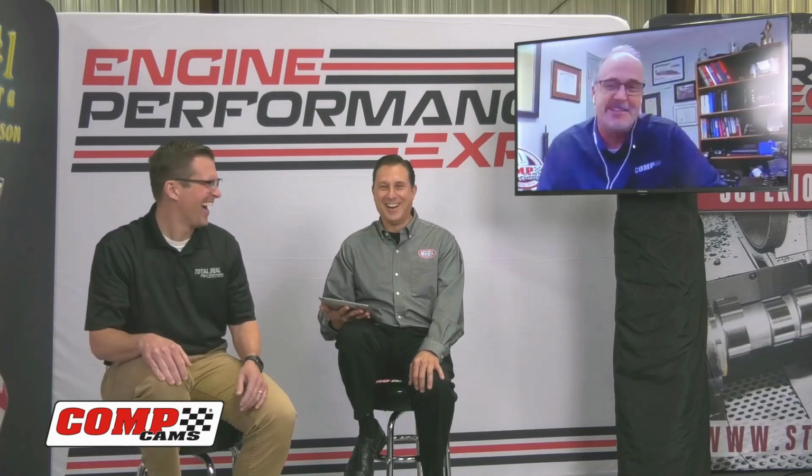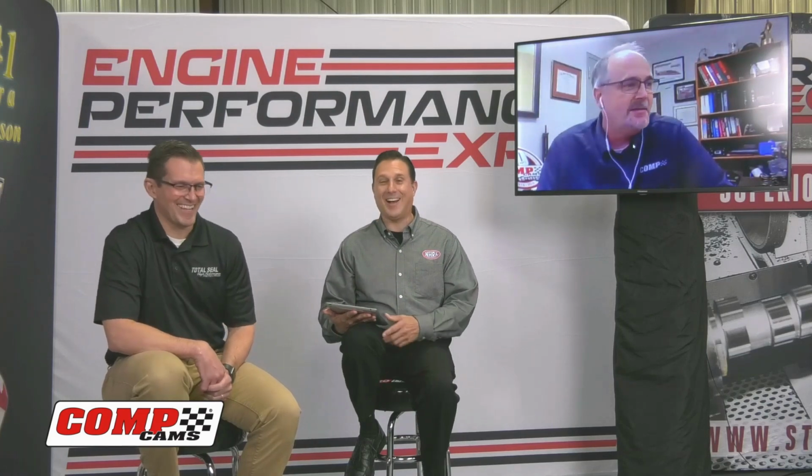You have to understand John's personality. He is as much fun to work with and as much fun to have as a friend as any human being I've ever known. To watch him laugh, we really just about laughed till we cried after losing 300 horsepower. You would have thought we'd gained 300 horsepower as happy as we were. But just so you know, don't try to go from 280 duration to 250 duration. If 280 was pretty good, 250 is going to be pretty bad. Hey, you moved the needle, though. Well, yes, he significantly moved the needle. Well, exactly. And John will have his opportunity tomorrow.